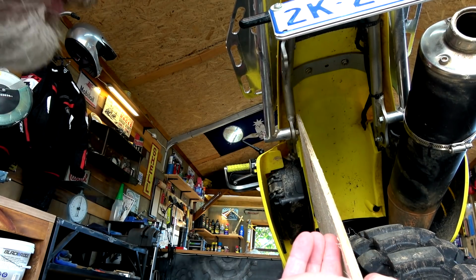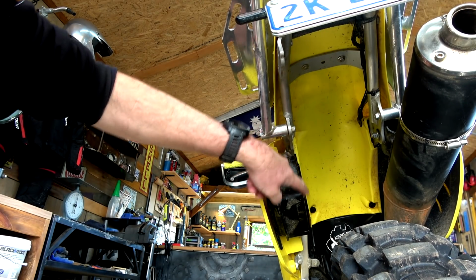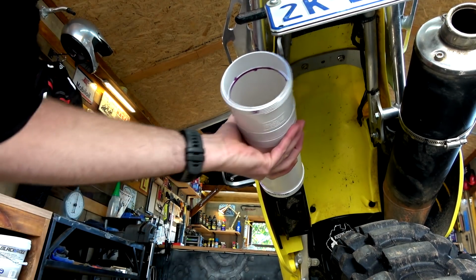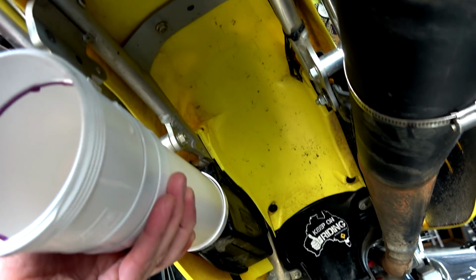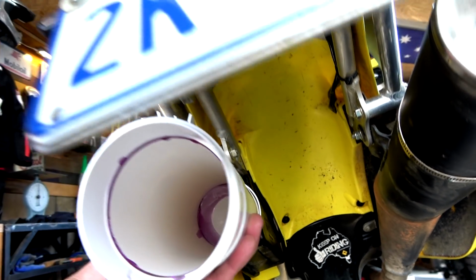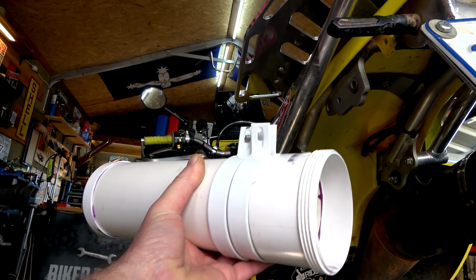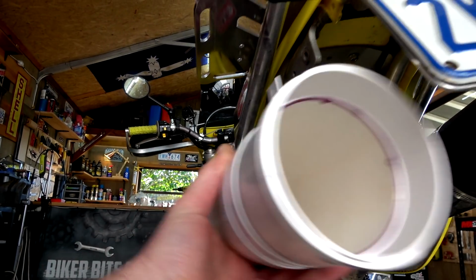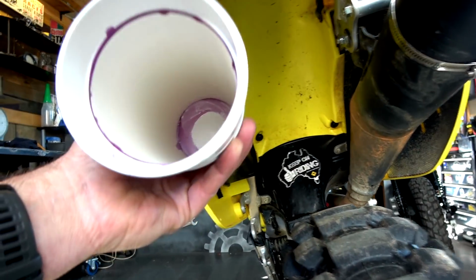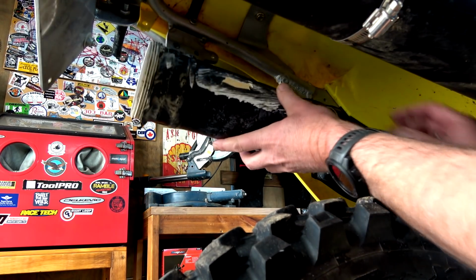But the back part, so we know that end edge there is very close to this wheel. When we put that on there, hopefully you can see that we're protruding past that just. So that's the issue on the DRZ400 running this size tube, as opposed to the DR650, no worries, but it's a bigger bike. So that's what we're trying to remedy and not have that wheel hit the side of this.